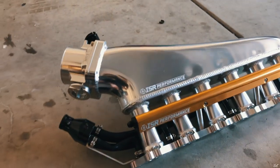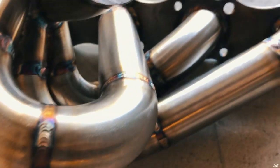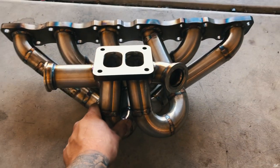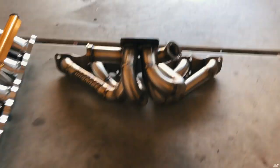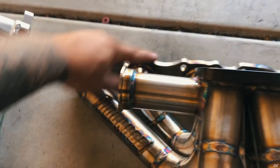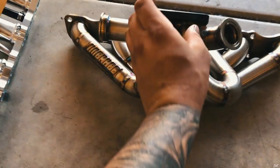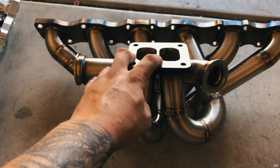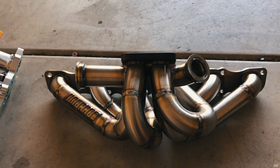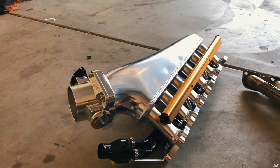It also comes with four vacuum ports — we'll see which ones I'll use. Then there's the fuel rail, which is very nice. It was all very easy to put together — didn't come with instructions but you can figure it out. There's a spacer that goes into the intake manifold flange, and a little 90-degree fitting — you screw the fuel rail to the 90 and set it down. There are lines on each side for fuel return. Now for the DocRace twin scroll manifold: twin scroll means the front three exhaust ports go three to one, and the back three go three to one — so instead of six to one, you get two separate three-to-one scrolls. I'll be running the Tial 38mm MVS wastegate with the Comp Turbo.